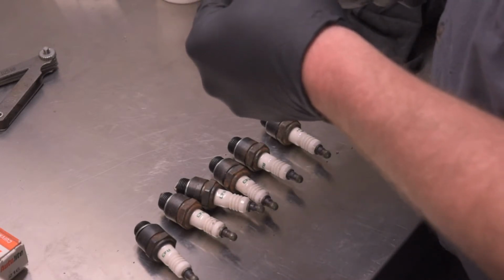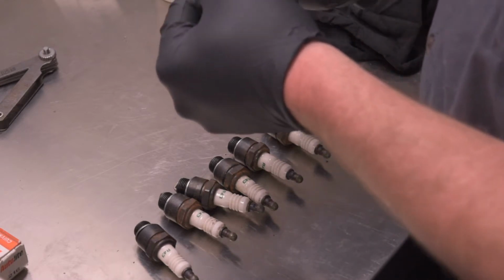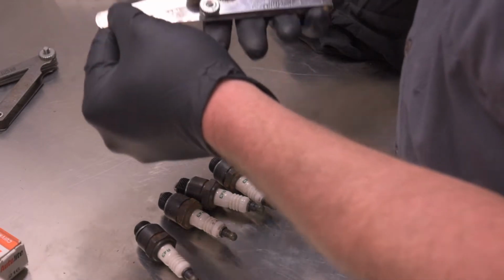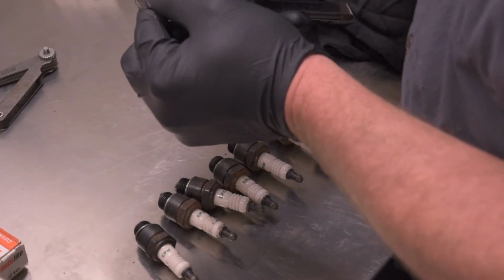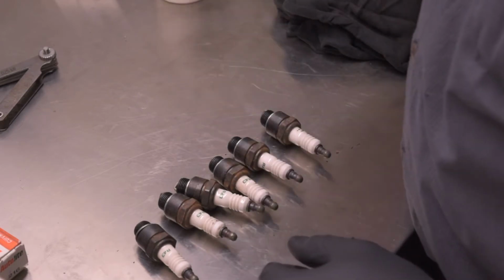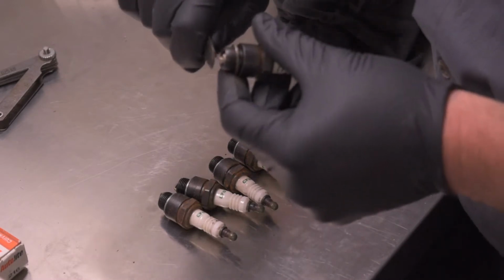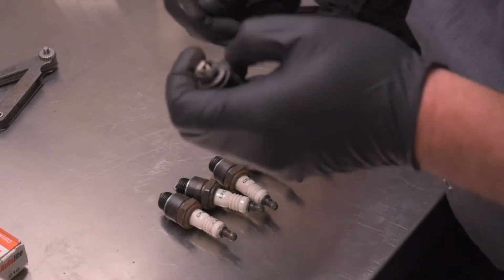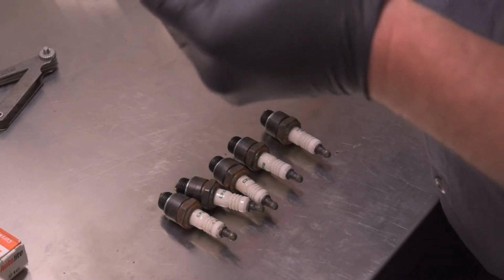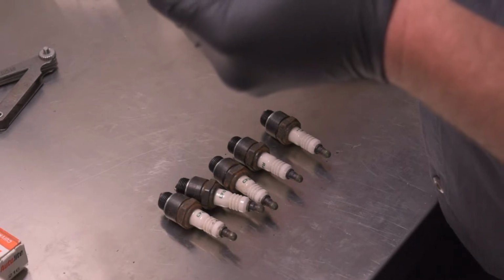So all of my feeler gauges only go up to 35 thousandths. So what you can do is double them up. I got 2 of them here. I got them both set at 20 on each of them. So that's an even 40. It'll pinch together to get a good fit. So you just want to take the gauge and run it through. You don't want it tight, you don't want it loose, you want it just snug. That's a little off. We'll put just a little bit on it.